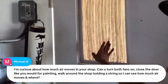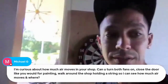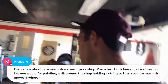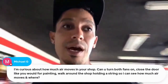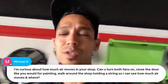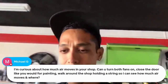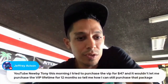I should change that filter out — it looks a little dusty. I leave it open about two inches when I'm painting, turn the fan on, shut the garage door, and it literally sucks everything out with a strong flow of clean air coming through. No major issues. For a full car I'd probably do it in a spray booth at my friend's shop, but I'd feel confident painting it here too.